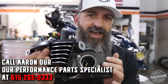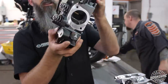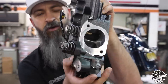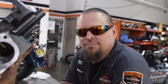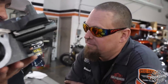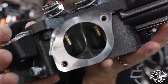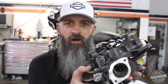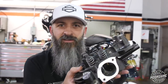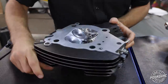On the M8 head, the exhaust side is mirror finished. The mirror finish allows exhaust gases to pass through without sticking, so no soot builds up in the exhaust port. The intake side is a little rougher — we don't need it as smooth. You have cold air and fuel going through there, nothing's really sticking, and you actually want turbulence on the intake side. We also have neck-down guides that are machine-done — exactly the same every single time, pressed in. We don't have to grind stock ones down like some other guys do.